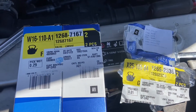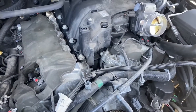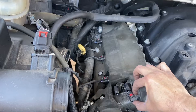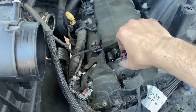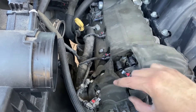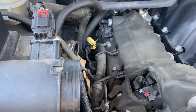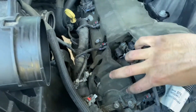There's the box — the part numbers are on screen for reference. I already took the cover off, which I did in another video on my page. I went ahead and took these two clips off — it's pretty simple, it's just the GM red clip: you push this back, pinch, and pop it off. I also unclipped this connector and unclipped it from here so I can lift this up a little better without shredding it.